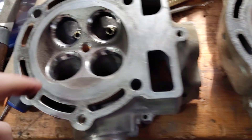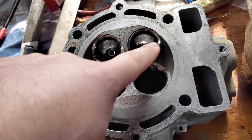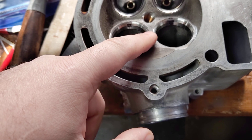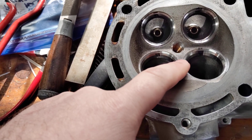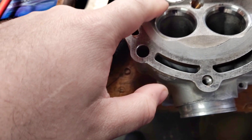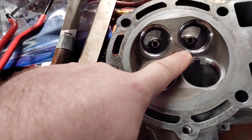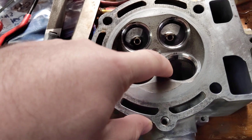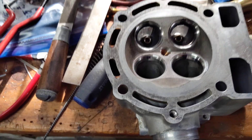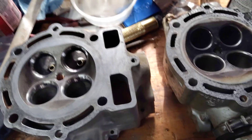The intake is kind of the same way — it just doesn't have as much throat area as I would like. Kibble white sells one millimeter oversize valves and I use those on all four positions. That fixes especially the exhaust problem, which is just not enough throat area, and it brings out the intake a lot better as well. So if you need your RFS head fixed correctly, I am happy to do so — don't hesitate to give me a call. Have a good day.